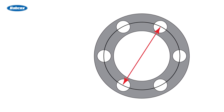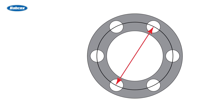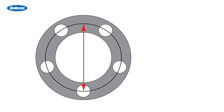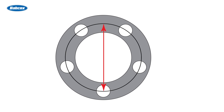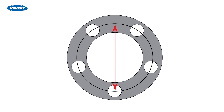This is easy when there are an even number of lugs, because you measure between the centers of two opposite holes. But it's tricky with an odd number of lugs, because the accurate point for diameter measurement falls between two lug holes on one side of the pattern. You can estimate the measurement, but if you're uncertain you can use a bolt pattern gauge to confirm it.